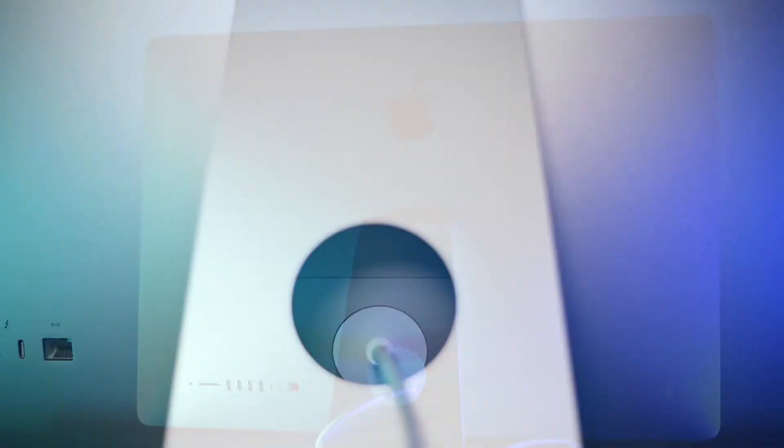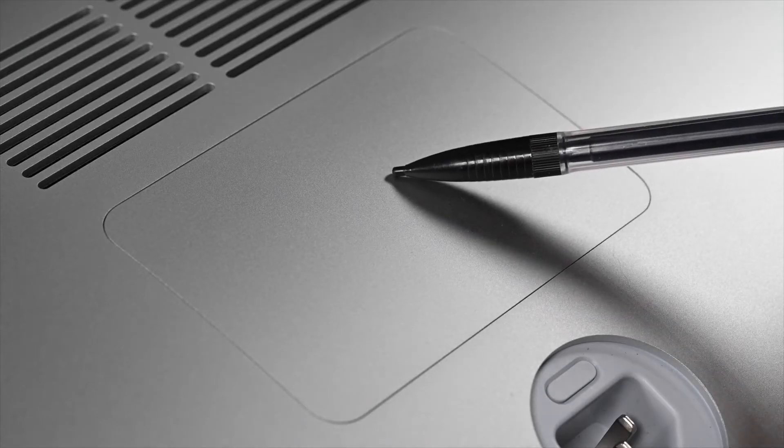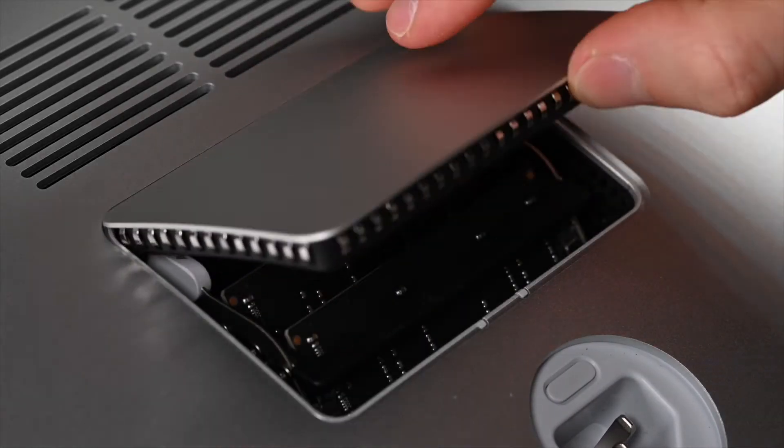Now that you know you can buy your own RAM and save a ton of money, let me show you how quick and easy it is to do it yourself. Items you will need consist of a microfiber cloth or a towel, and a dull pointed object to press a small button — I personally chose a mechanical pencil. To start, turn off your computer and unplug it. Then gently place it face down on its screen so you can access the backside. This is the RAM door, and this is the button you need to press to open it. A firm press will make the door release so you can remove it.